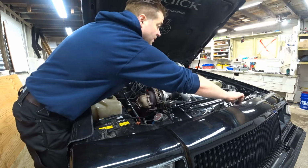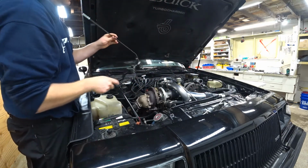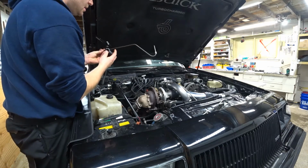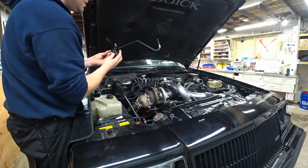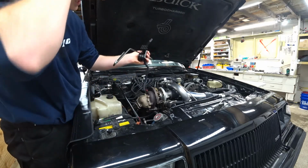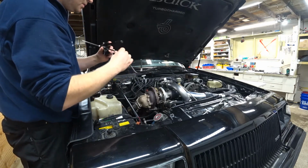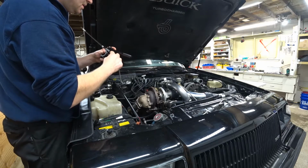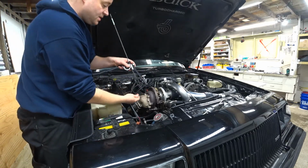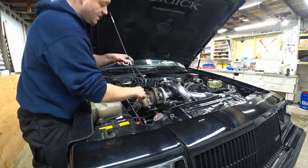So I'll get this tube, open it up. Stick it on the right channel. I say the right channel, this thing has 3 sets of grooves for different diameter tubes. So you pick the one that's right for the tube you're using. This is actually a really useful, really neat tool. Well made and simple. So what I need to do is bend it towards this way on the tube.